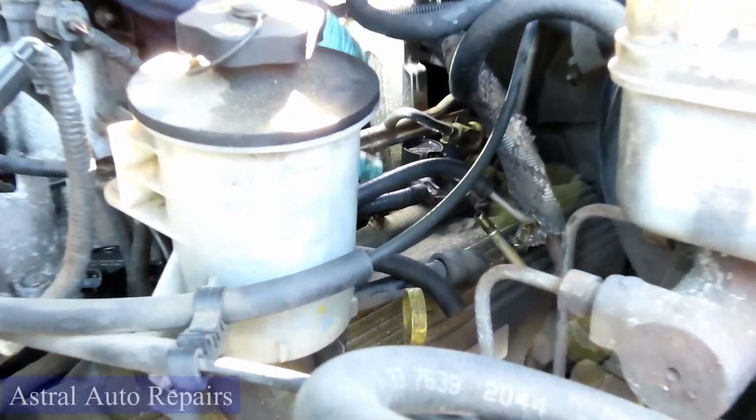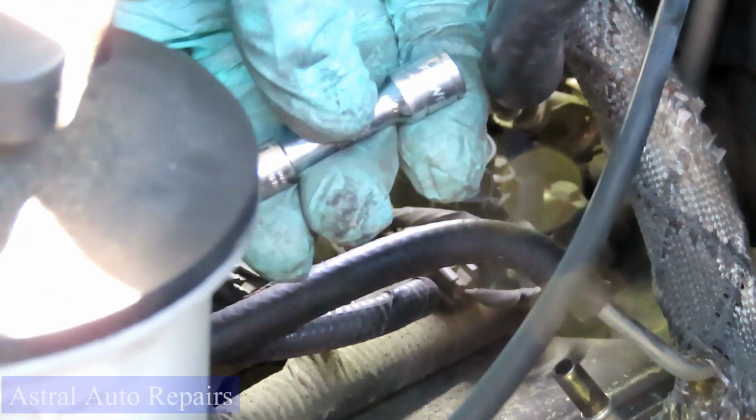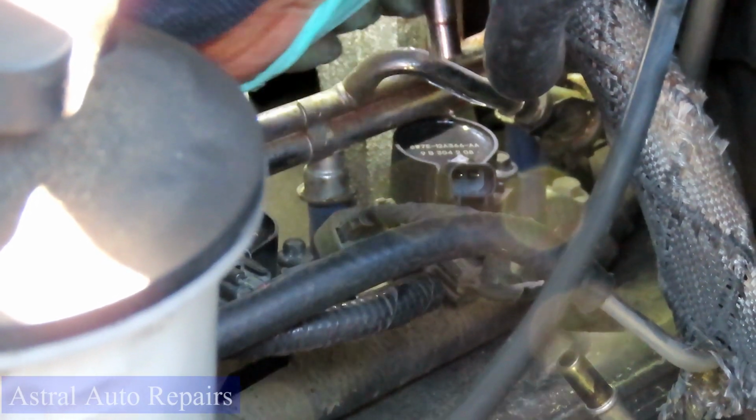All right, guys. This one way back here on the driver's side is very difficult to get to start off by hand. So what I did, I got it lined up. Now I'm going to take my 2-inch, 1/4-inch drive wobble extension with my 7mm shallow socket and bring it over there, just like that, to bring that down till it stops by hand.